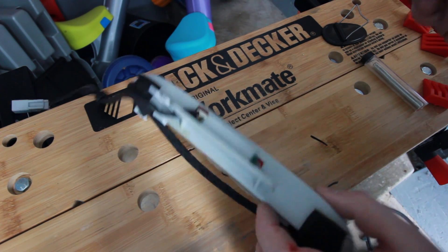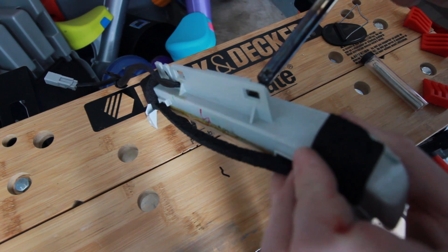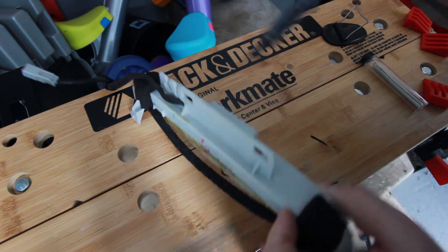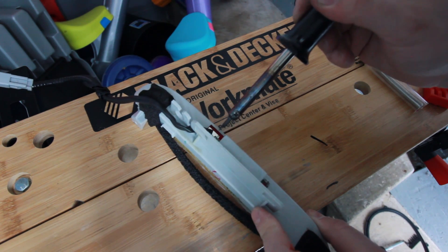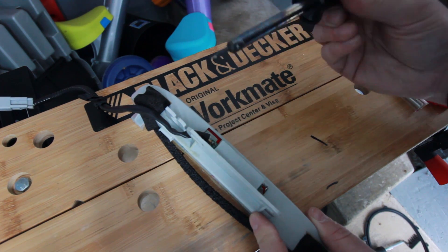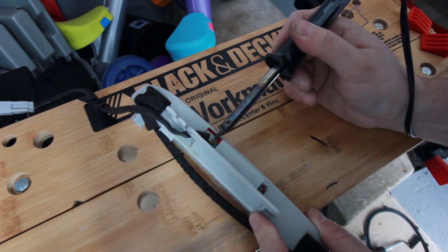Again, you want to do this in a ventilated area. Let's see if we can clean up the solder here. I think it's the power connections — I don't think it's the connections to the actual light. If you look at these they look pretty gross, so let's see if we can just heat them up and redo it.